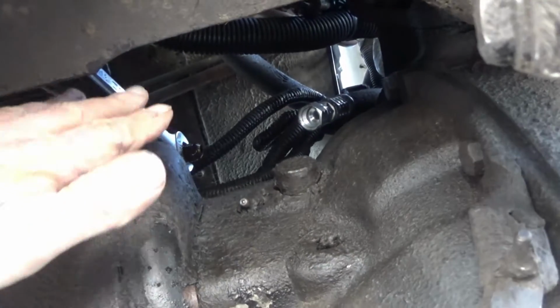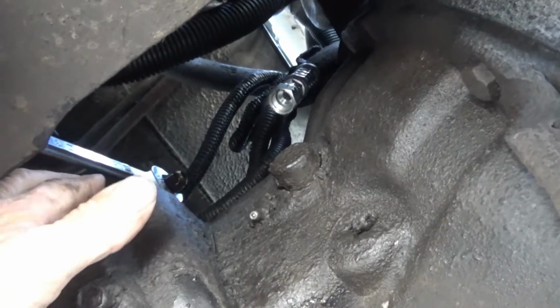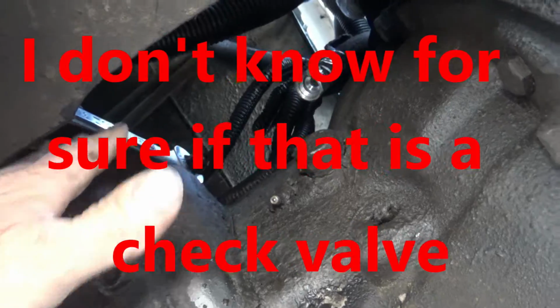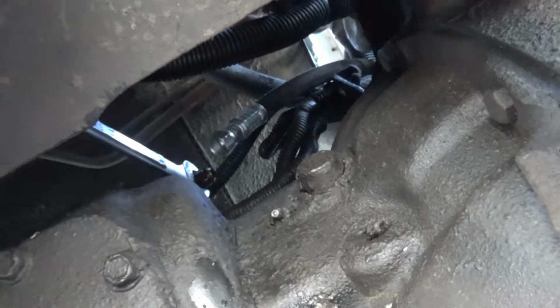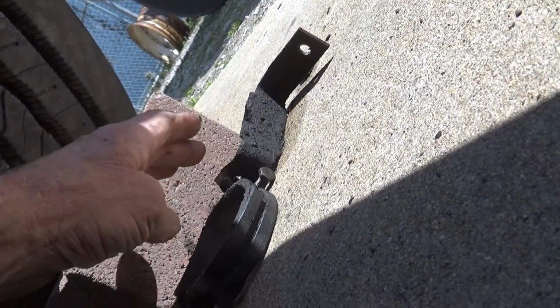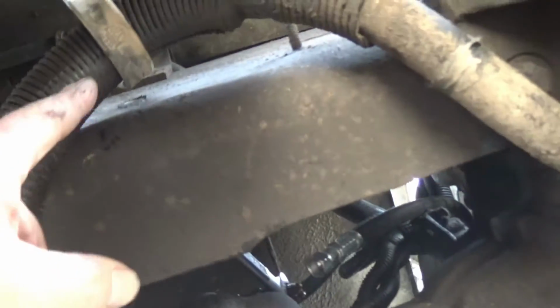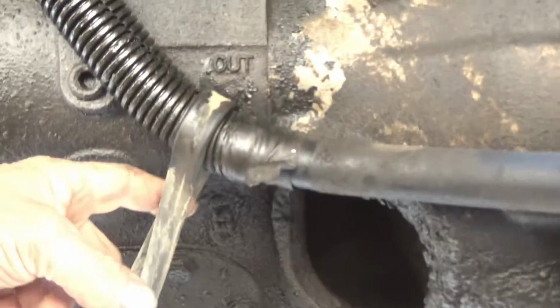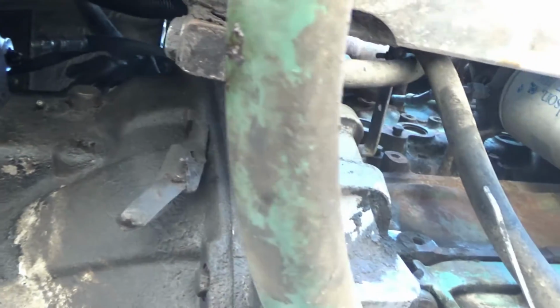Down here under the truck, I still have a wrench on. No, that's an 11/16 that was in the middle between the check valve and the fitting that goes on the hose. So now all I gotta do is get the hose back over here, get the thread started on there, and then tighten that down with a 3/4. And then got to get these hose clamp brackets I got for the heater hose lines. Got to clean that up and get that back up here on the frame, and then get my hoses, which are tied back with bungee straps right now. I'll get those back in that hose clamp bracket where it belongs, and then I am done.